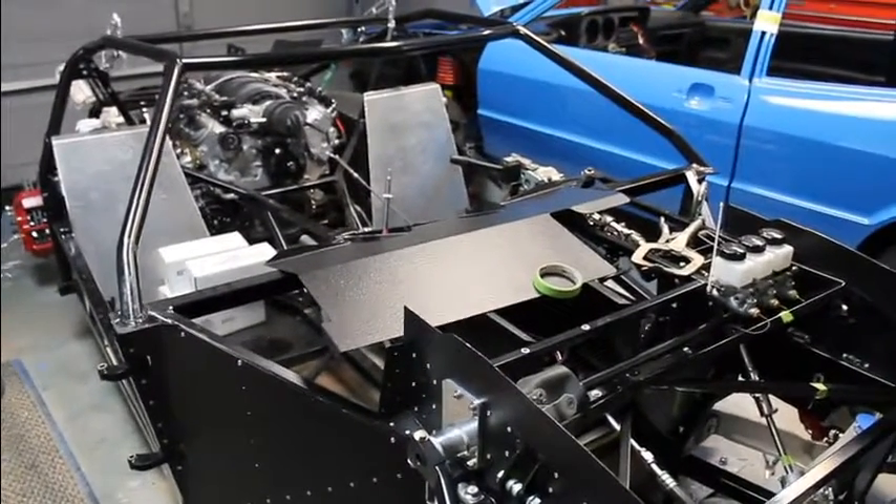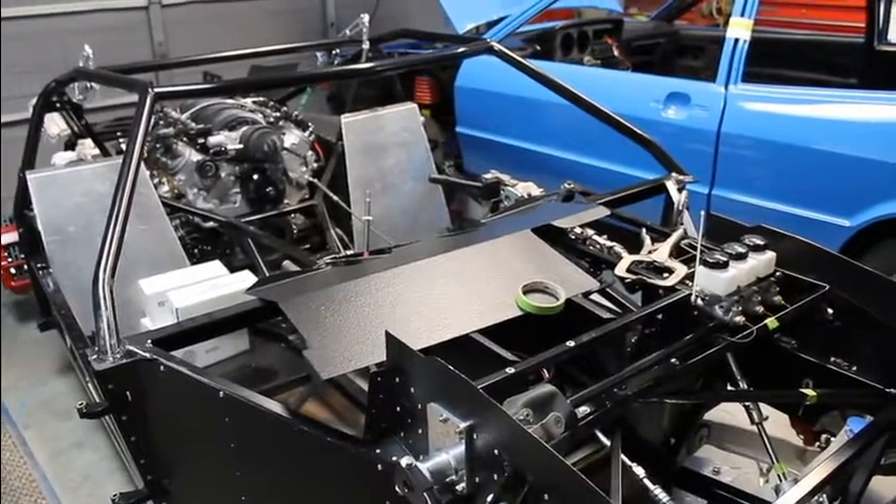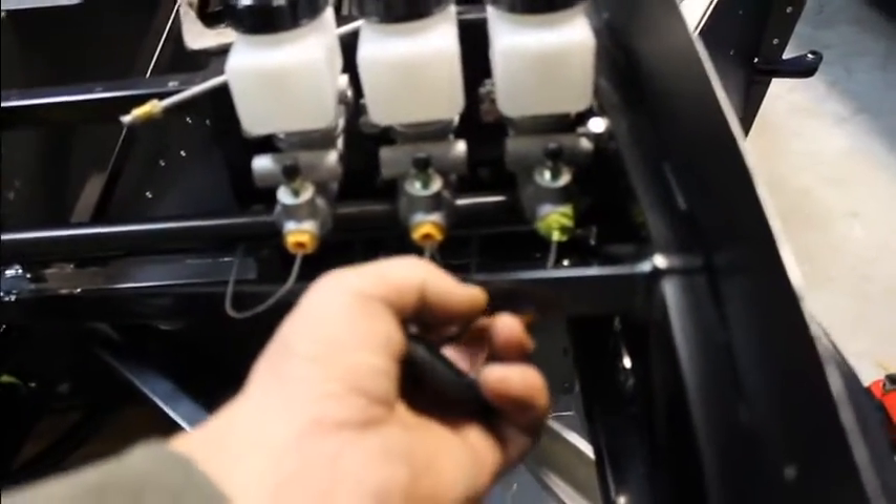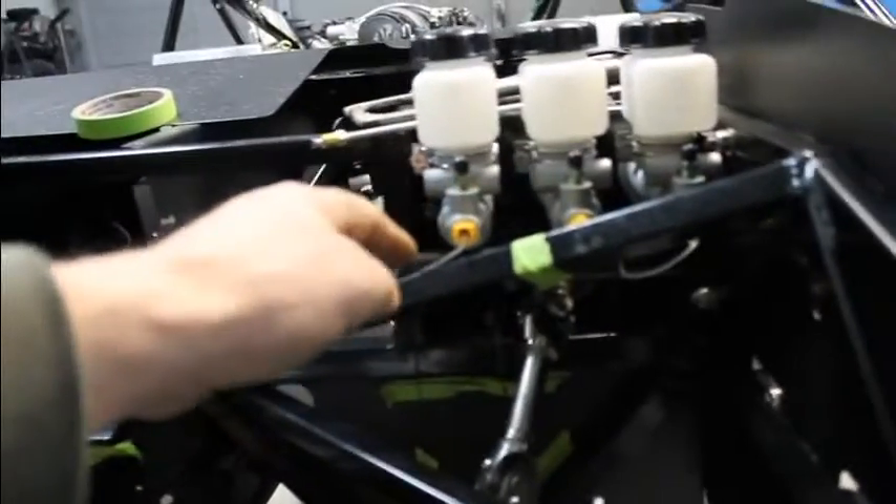The brake lines kind of go in — you want those tucked in and not interfering with the other stuff, so that's what I'm doing now. I took some nice bendy wire and mocked up how I want the actual brake line to go, trying to figure out how it'll look best. I've got each one wrapping around, coming down around the sway bar. I'll bring the rear brake down, go underneath the front brake, split right here, branch out to each side, and then the clutch line will run down and go back.